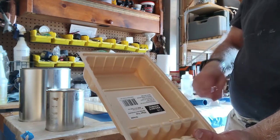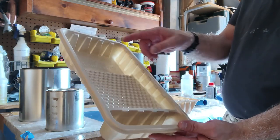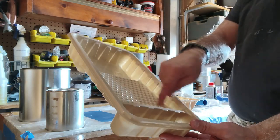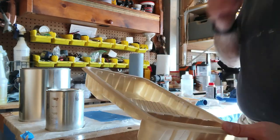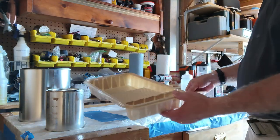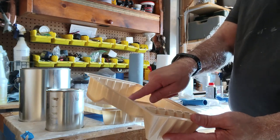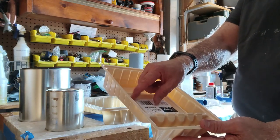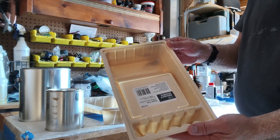I actually did originally use the six inch roller and you'll notice bumps in the pan. You might think that would help the paint filter back down, but the problem is that puts indentations on the sponge roller and you don't want that — you want the paint surface as smooth as possible. Just put a small amount in the pan, roll it back and forth on the nice smooth area. I'm going to go ahead and re-roll the front and door that I did last time, to see how it turns out.